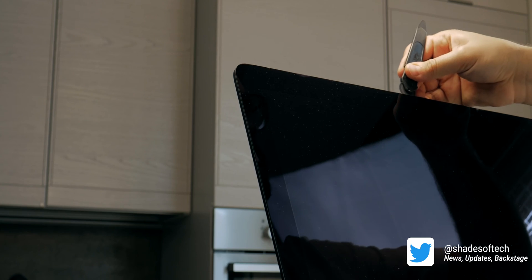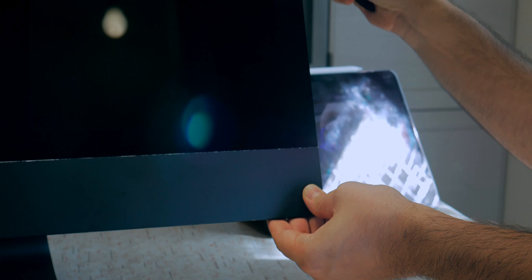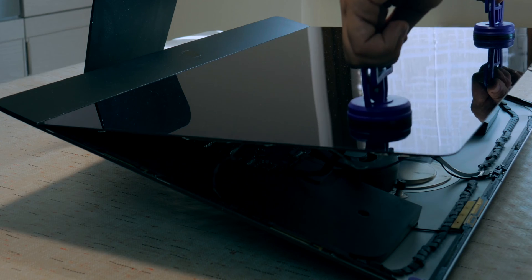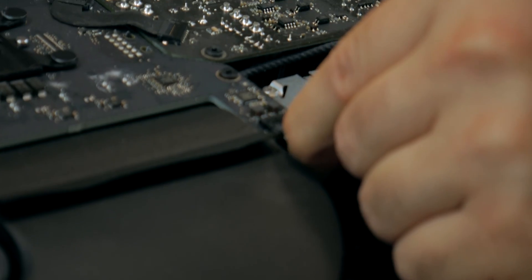Getting to the CPU is the most difficult part of upgrading an iMac. I found myself comfortable doing this upgrade even though it was my first time, but you need to open the screen — so you have to gently cut the screen glue with the pizza tool, and after 10-15 minutes you're able to open it and disconnect it from the motherboard.